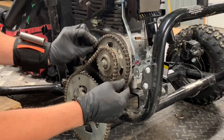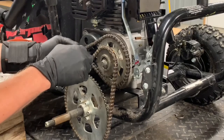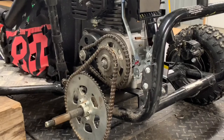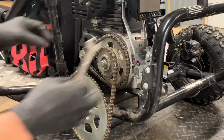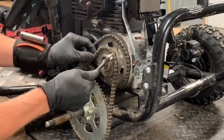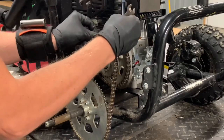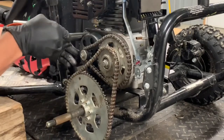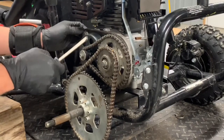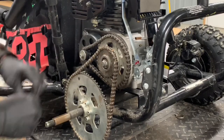Those chains — this one actually could be tighter. So what I'm going to do is loosen these up just with a wrench. Because these sprockets are so small, these are a lot bigger. There's almost no free play here. This one here is getting a little on the loose side, so you want to make sure you don't get it too tight. I just take and stick my screwdriver in here, and that's about where we want it.